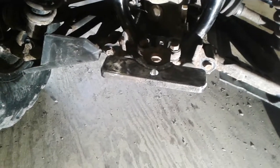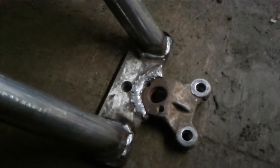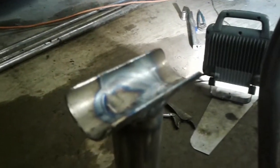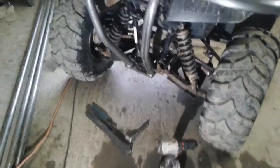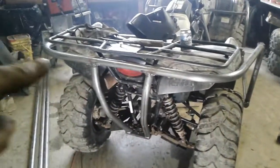We'll get these tubes up and get them in there. That's the tail section, all welded up - that's where the hitch was. I just welded that on where the hitch was. The big hole is where the ball is gonna go back on, and I gotta drill the other one out for my clevis. Welded all the way around - that piece of half-inch is pretty heavy. That lets me unbolt it down there, and these snap over the frame and get drilled and tapped, so I can remove this tail section if I ever need to work on the bike.